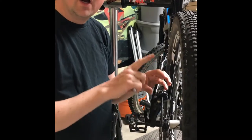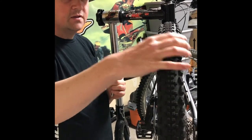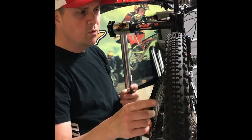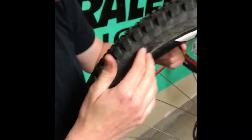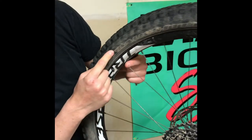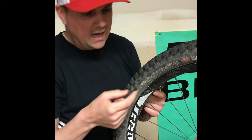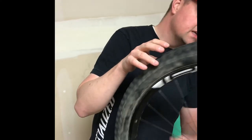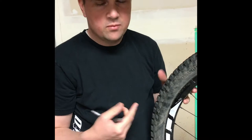The rear's taken care of. We've gone through the derailleur and the caliper. Next I want to look at the tire, moving backward to front. The tires are pretty low from sitting all winter, which is normal. I'm running tubeless tires, but I want to make sure there are no cracks in the tire. I slowly go through the sidewall to check for any cracking. My bikes hang up in the garage so there was no weight on the tires, but in the past I've had bikes on the ground all winter where the tire got flat and developed cracks. Both sidewalls look really good, so I'm safe to pump up the tire. If you do see cracking on the sidewall, I'd recommend getting a new tire.